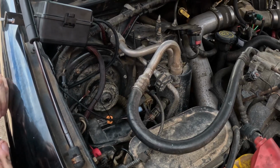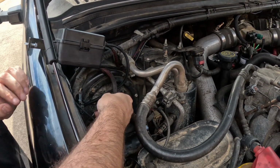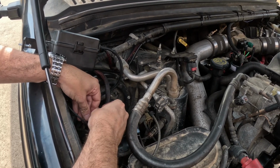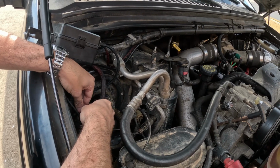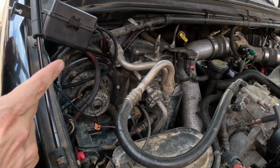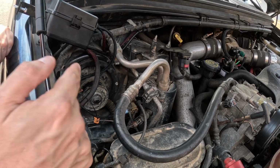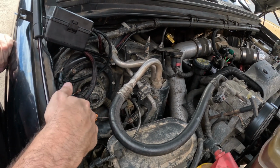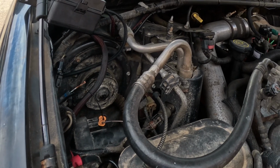Okay, now that I've got the wire stripped, I'm going to go ahead and slide my heat seal splice on there first, before the wire gets too splayed open. Otherwise it's a pain to do this later. That way you don't forget. It's one of those things where once you have all the wires spliced in, you forget that you're missing the connector, and you have to take it all apart, and it's no fun.